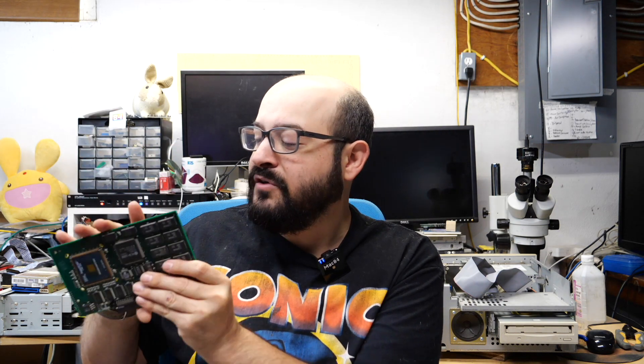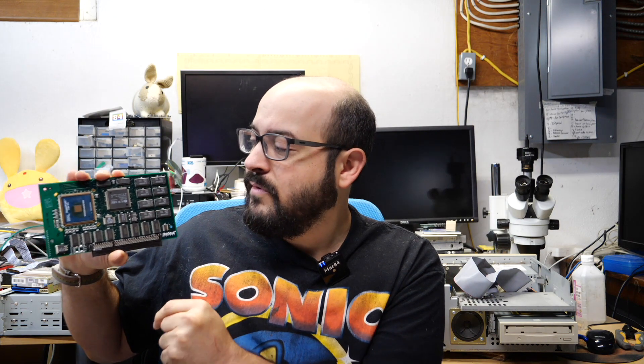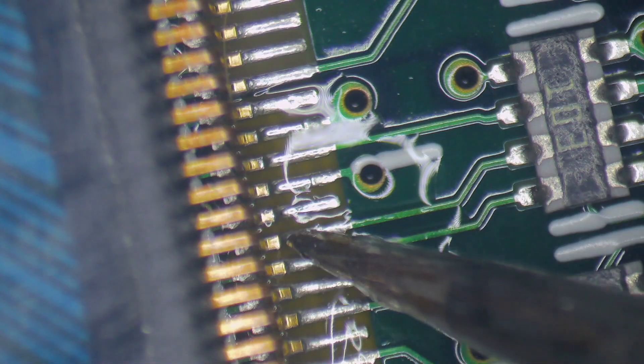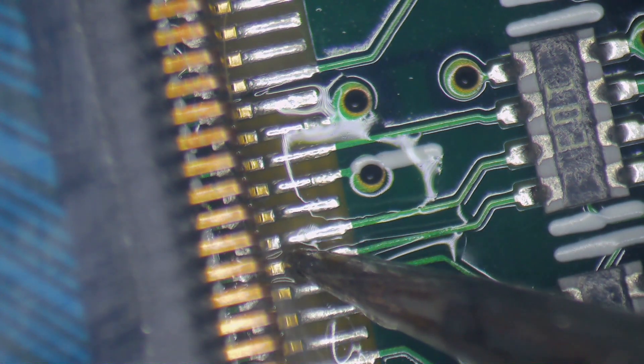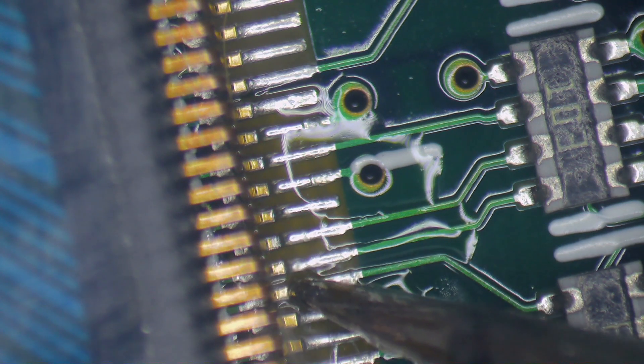The capacitors looked to be in good shape and they were tantalum, so I didn't think they needed to be replaced. However, when I inspected the pins around the entire processor, I found that there was a problem. Even more of those pins were not making a connection to the card itself — there were dozens of pins just dangling around, not touching anything. So I went through carefully with my soldering iron and made very, very careful joins of these pins onto the pads. This was tedious work, but I knew all those pins had to be securely connected if this card had any chance of working again.